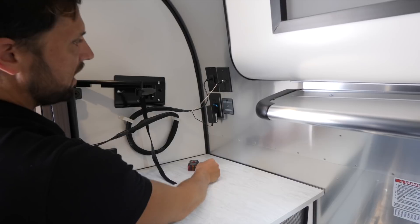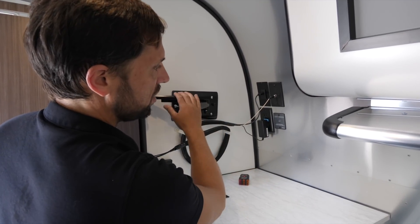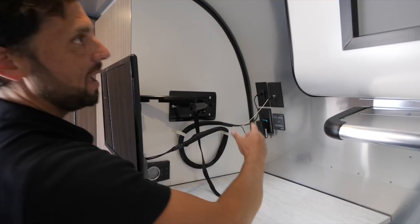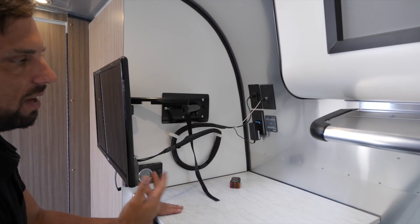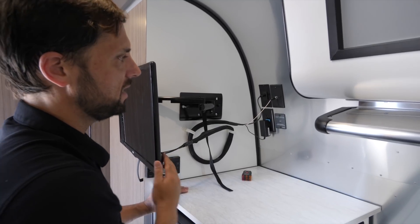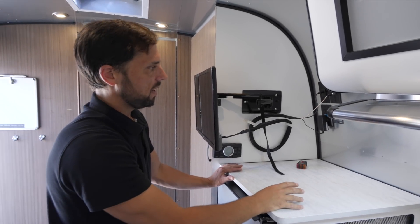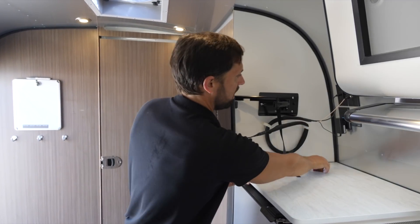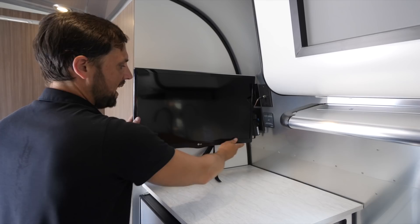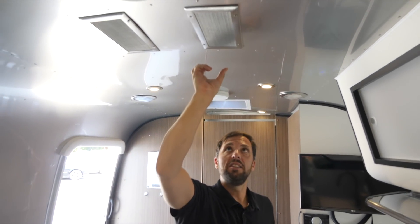The television plugs into a coax cable inlet. To power the over-the-air antenna and get digital HD reception, turn on the 12-volt antenna booster — a green light indicates it's on and boosting the signal. Then go into your TV's mode settings and scan for channels. When done watching, shut the antenna booster off for two reasons: it drains your battery quickly, and if you're hooked into cable at a campground, it will distort your signal. Also make sure the TV is locked in place and latched before towing.